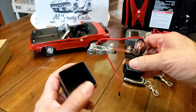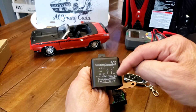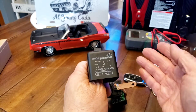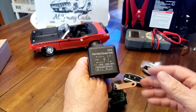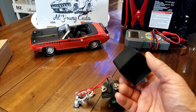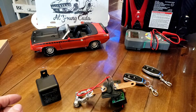This comes with a little screw so you can bolt it anywhere. On terminals 30 and 87 you can see that the door is open — disconnected. When you put power and ground to the coil, that's an electromagnetic coil. It pulls that bar — that open door — closed, makes the connection, and you get power. When you shut the power off, the electromagnetic field lets go, the little bar swings open, and there's no power. It does say 200 amps, which would normally be okay for a car. The only thing I don't like is that the relay runs all the time — in order for your car to run, this has to stay connected, electromagnetic and all. So I don't know if the terminals inside are going to last long enough, but it's a nice little gadget.